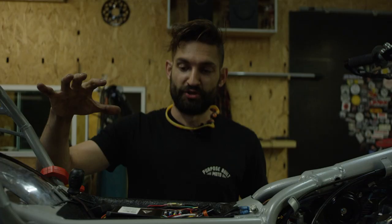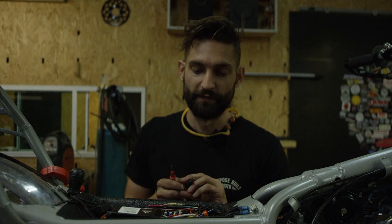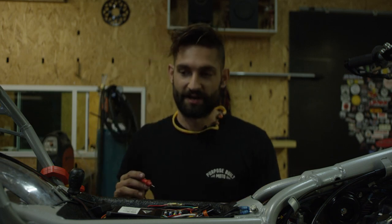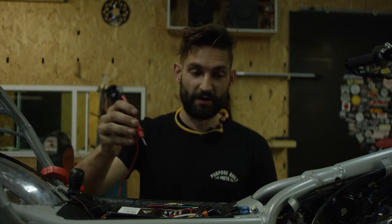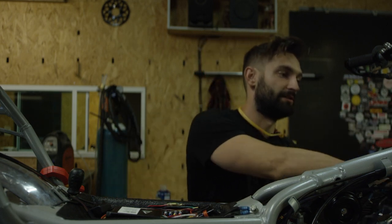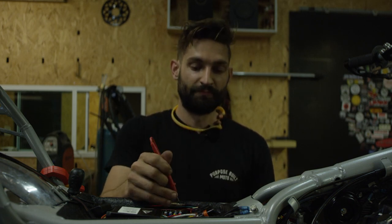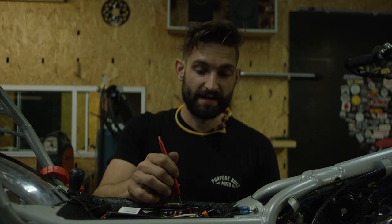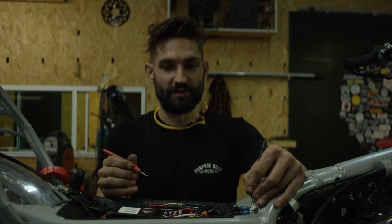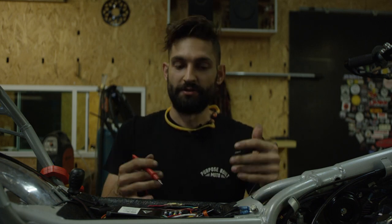I've knocked over the completion of the wiring — lights are connected, starter solenoid is connected, everything's ready to run. Final check before you turn the key: making sure all your fuses are removed, then firstly checking your earth from end to end — going onto the negative terminal of the battery and checking you can pick up an earth from one end of the bike through your earthing points onto the motor and up to the front where your lighting is connected. Then test through battery connections on the positive side, making sure you don't have a connection to your battery when the fuse is out, and checking there are no earth connections on any positive terminals. If nothing buzzes out on the multimeter, you're ready to go — plug your fuse in, nothing's going to blow.